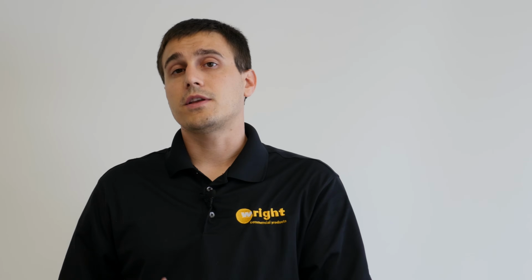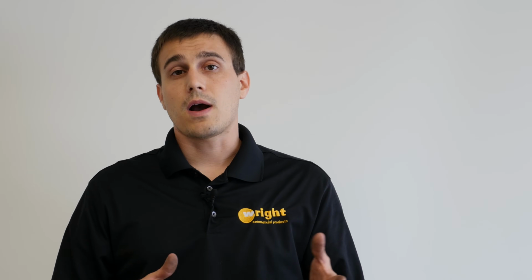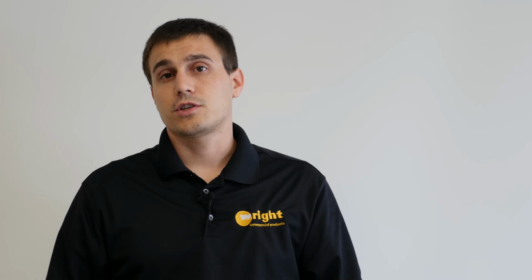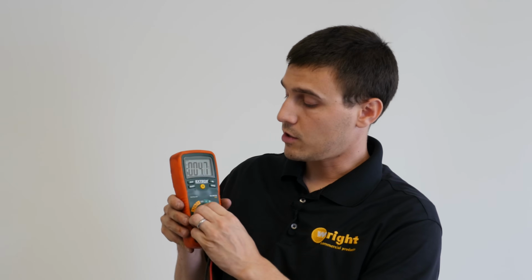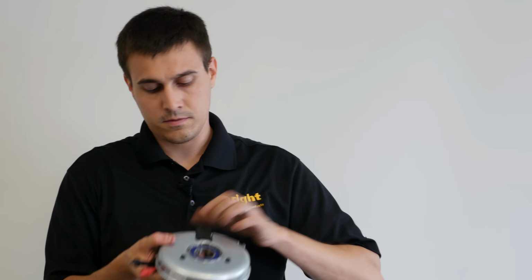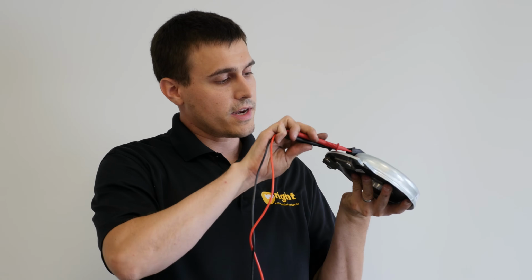If it is getting power, then you know your problem's within the clutch, or a problem of power getting to the clutch. So at that point, what you want to do is identify if the electromagnet on the clutch is still performing how it should. And the way you do that is you take your multimeter, you set it to ohms. And each clutch has a different ohm requirement, and generally it's between 1.5 and 2.5 or 3 ohms, somewhere in that range. And you can just connect that to the two poles in here, read the measurement, and make sure that you have the right amount of resistance.